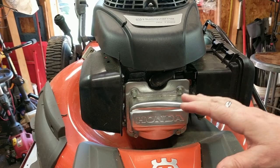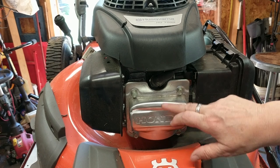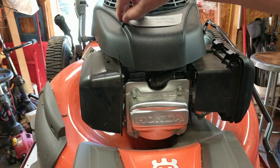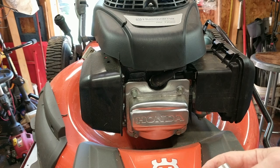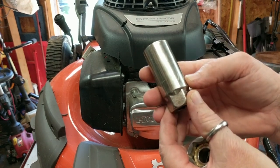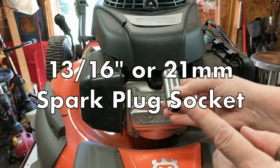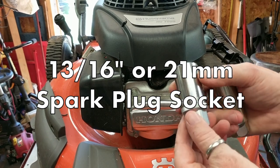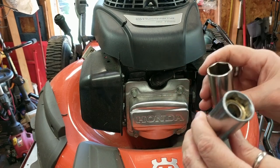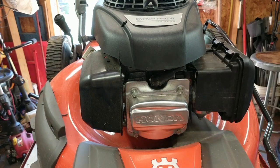Next thing is we're going to take a look at the spark plug. I just noticed the valve cover is bashed in as well as the spark plug cap, and there's a big hole — maybe some sort of shipping defect. The spark plug socket I'm going to use is either a 13/16ths spark plug socket — it has a rubber boot inside that helps prevent breaking off the electrode if it comes in at an angle. I've recently started using a 21mm with a magnetic tip because these tend to get stuck on the spark plug itself — so that's what I'll be using.